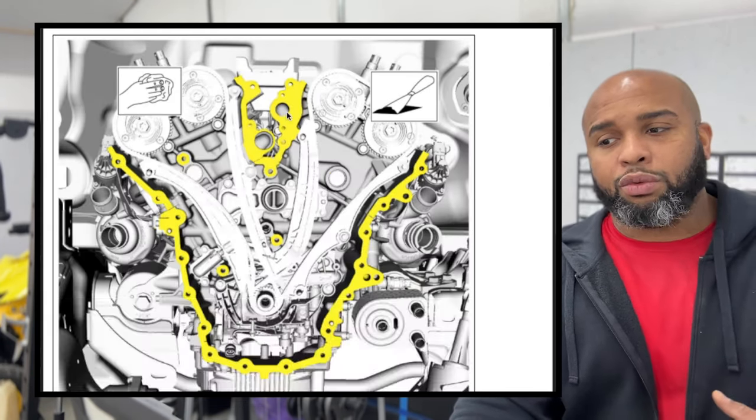What we're gonna do now is get our complete intake up top with the new gaskets, talk about that, and then close this out. So the final thing that you all are gonna be doing is getting the intake in. We're almost done. As you see right here in this part of the video, it is showing that there are gaskets that Ford does recommend that you replace, throw in the trash. So these are gonna go in the trash. And what we're gonna do is go ahead and get our new ones installed. They're gonna be linked down in the description section as well.